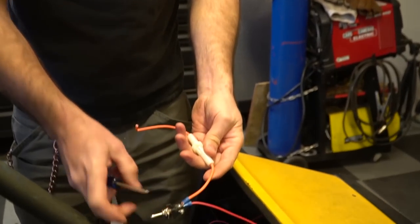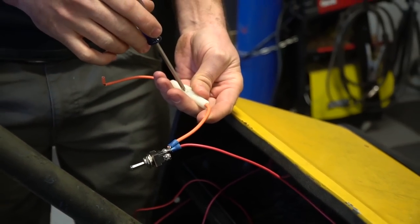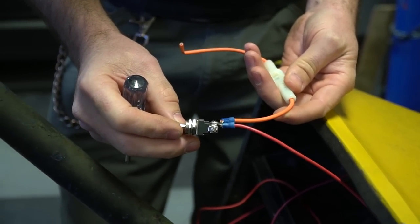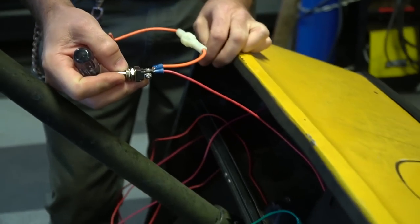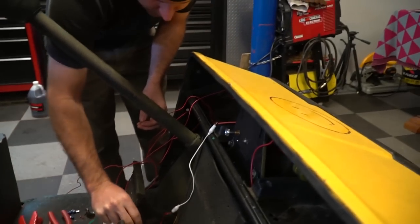What I've got going on here is a 30 amp fuse, which is way more than what we needed — I might step it down to a 20 amp fuse. It's going to be operating the turn signals and also powering the regular lights. We're running into a small issue because we're using LED lights. There's not enough power draw to make the turn signal flasher happy, so they actually don't blink very much. If they're not blinking a lot, we can just add some more LEDs in the dashboard so we can tell when the turn signals are on.